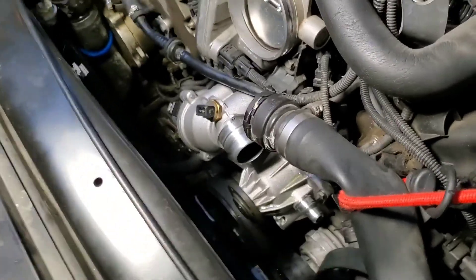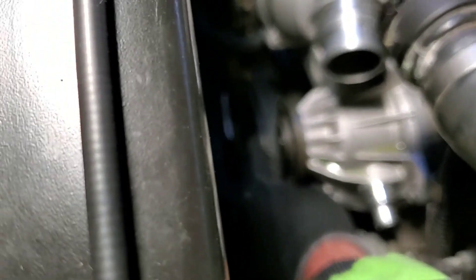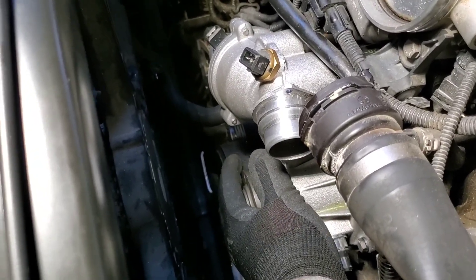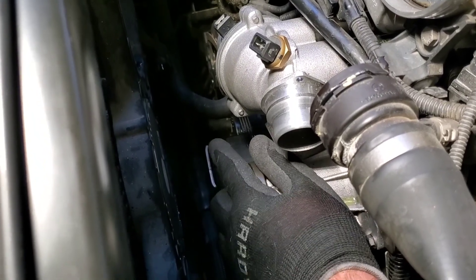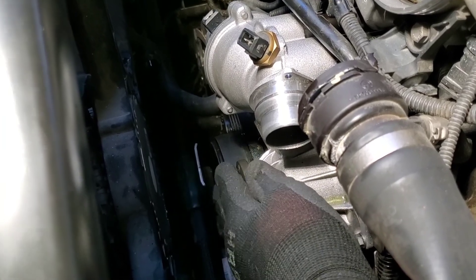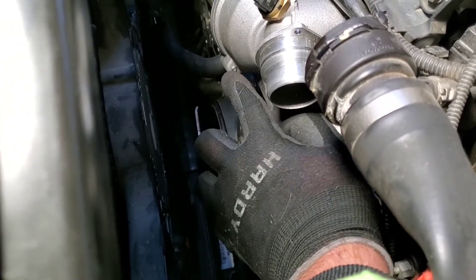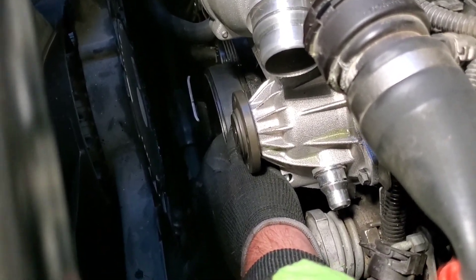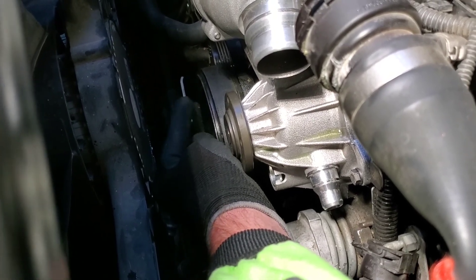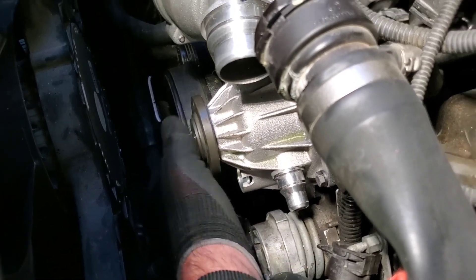So when I was going to put the crank pulley back on — this little jewel — it has eight bolts that hold it in place, as we already know. And you saw in the last video where I took off that metal ring — it's like a big washer with eight holes. Well, there's a little pin on the actual pulley. There's a ninth hole and that little pin lines up with all the other holes. So you can have the pulley anywhere, and that pin is happy to go into any of the bolt holes, but then none of your bolts actually line up with the actual bolt holes they need to line up with. So you have to make sure that that one little tiny pin is in the correct position. I actually started this at one point and had to take it back off and look in there with my mirror to see that the pin was actually in its correct hole and not in one of the adjacent bolt holes.